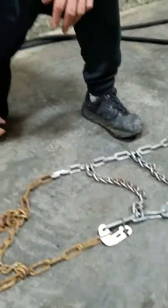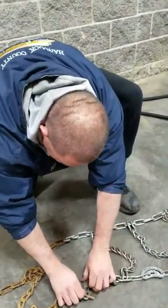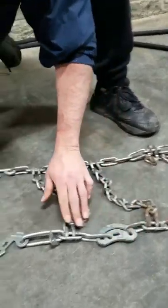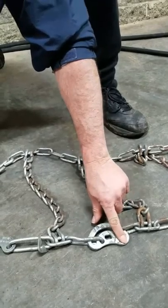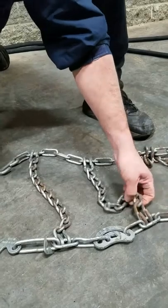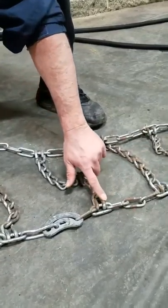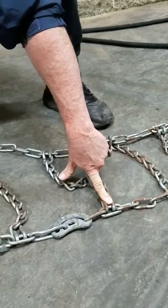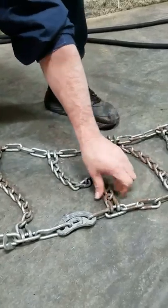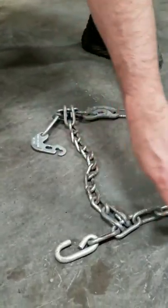This is what we call a cam lock style of tire chain, and it's called a cam lock style chain because it has these cams on it. These cams have to be to the outside of the tire. These hooks on your cross-links, what we call knuckles, have got to be installed knuckles up — facing the up position. If the knuckles are facing down, that is upside down and you can't install it that way.